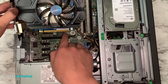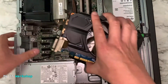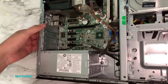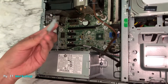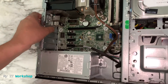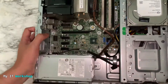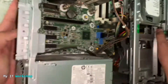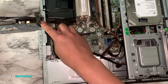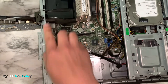The socket and connector have to match — in this case they do, which is important. You can remove these expansion slot covers to add more capabilities to your desktop. We need to remove four of them to fit the video card. One thing about this model: the video card sits higher than the case, so you won't be able to put the case lid back on.